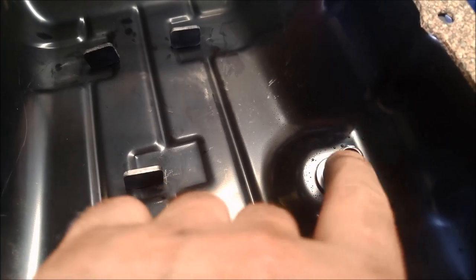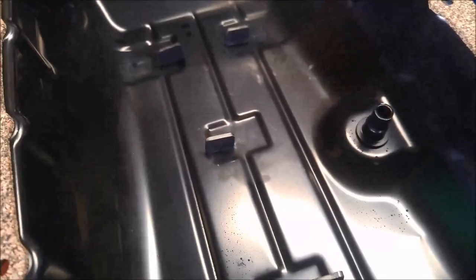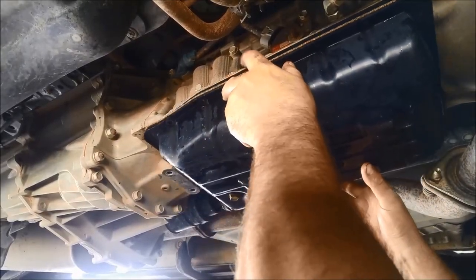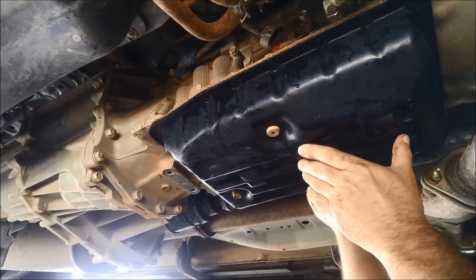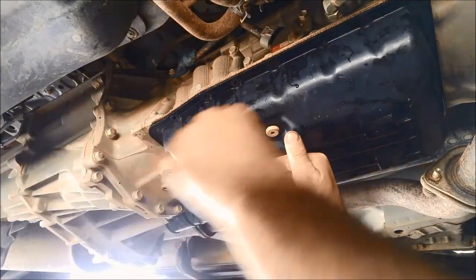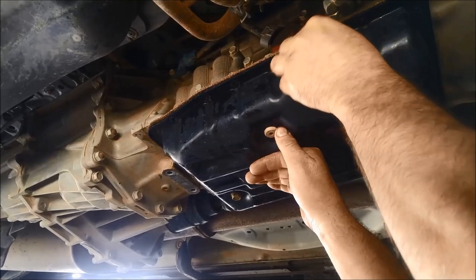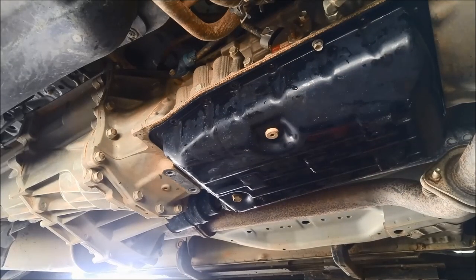You can see the oil level height. Because it's such a big pan you can put a couple of litres of oil in there, but it's pretty easy to fill through that little side plug I showed you earlier. If you're putting these cork rubber pan gaskets on, it's always a good idea to have the pan rail completely dry. I'm going to put all these bolts in just loose before I tighten it up — that way I won't have a misalignment issue.